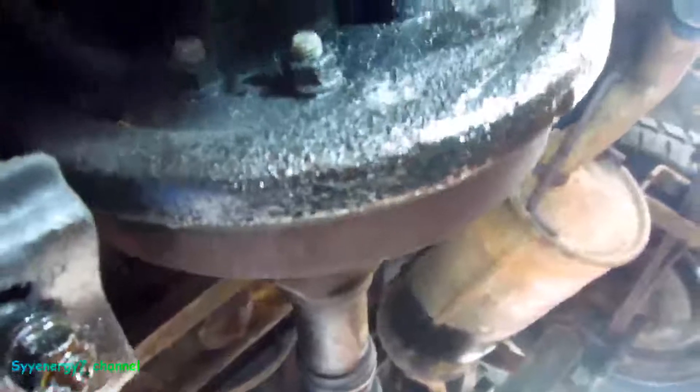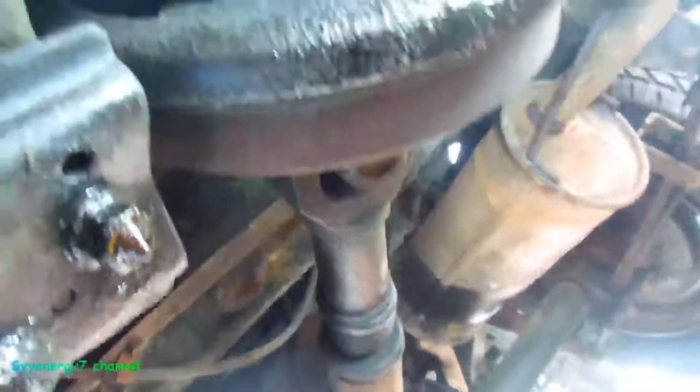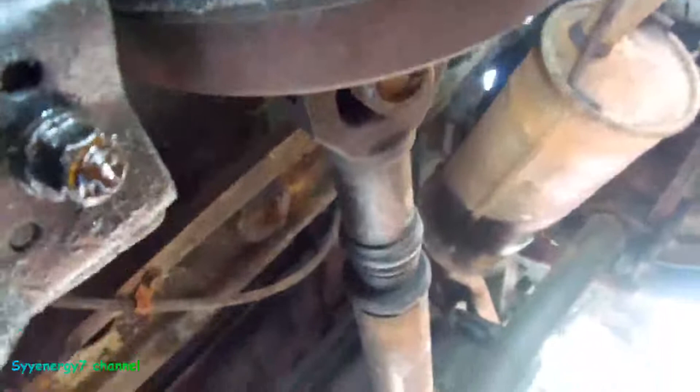I know it was full. You can see how much is spinning off the back of the pinion seal. I know the front pinion seal was leaking a little bit too but I hadn't really been using it in four-wheel drive. We'll be changing the front and rear pinion seal. This is a rebuilt transfer case, rebuilt by AAMCO back in the 90s with low mileage, but it's been sitting a long time. The bearings are good in it so we'll change it out and see how low on fluid we are.